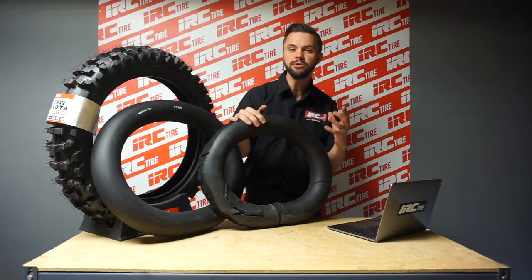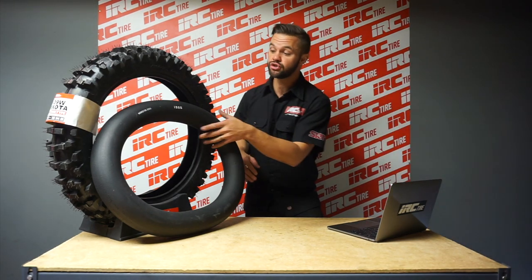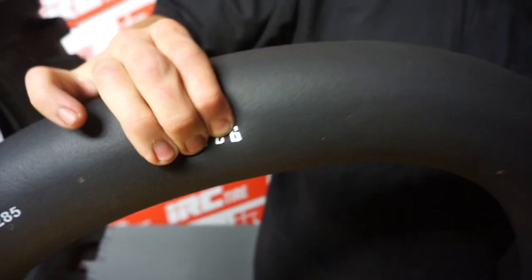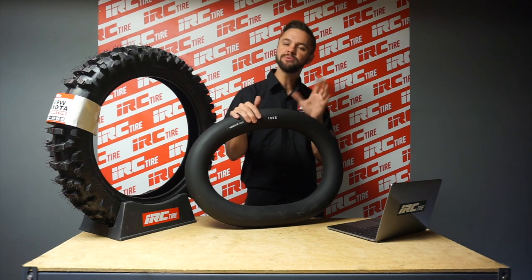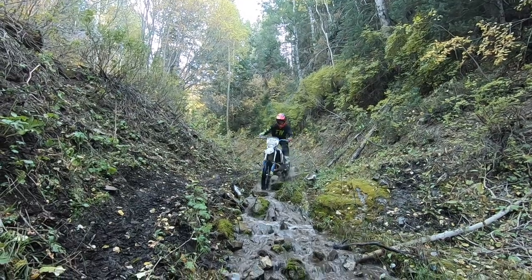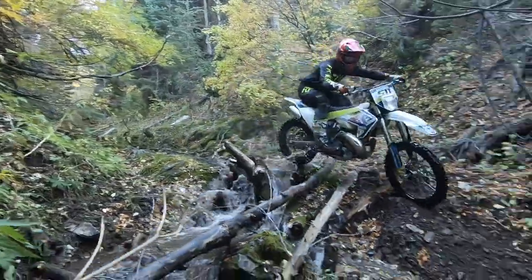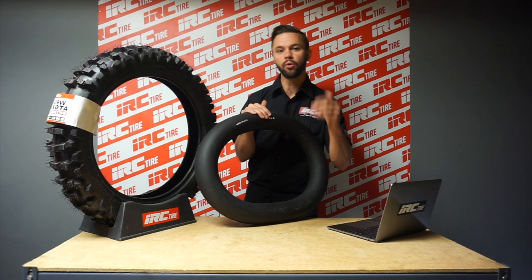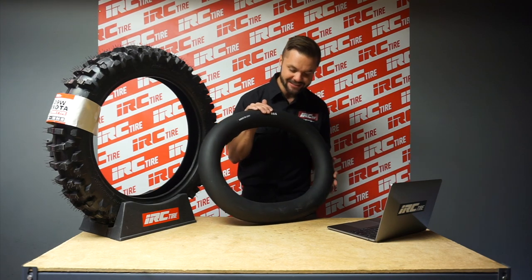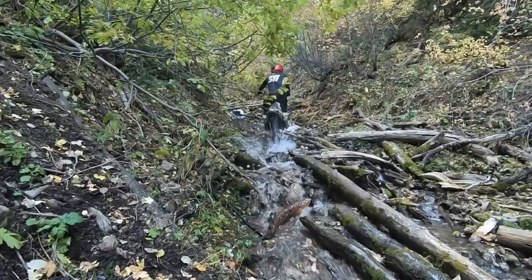These options can get expensive because the mousse tends to wear twice as fast after customization. Now there is a new soft option from Nitro Mousse — their soft mousse is advertised as four to six psi out of the box. When I tested it brand new it was around six to eight psi. For guys who can't afford to customize and then buy a new mousse every month, this is a great option for a soft feel right out of the box. I've tested these and they work well, especially for higher speed extreme enduro or enduro cross. I like this option because it offers a softer feel but still fills the tire. I still prefer the customization performance for really extreme riding, but I understand that can get expensive.